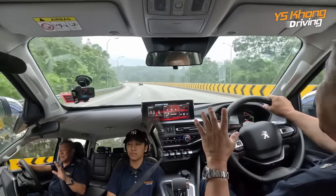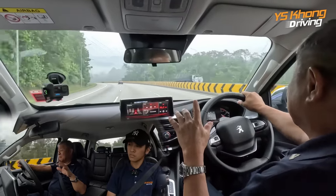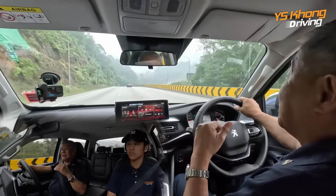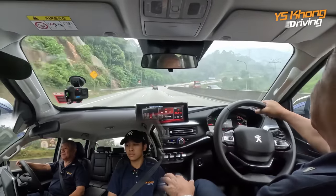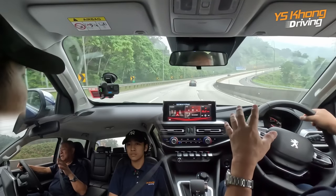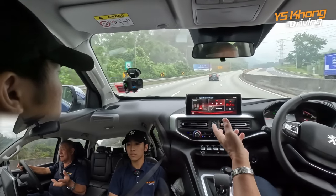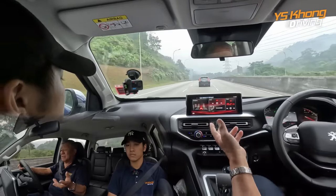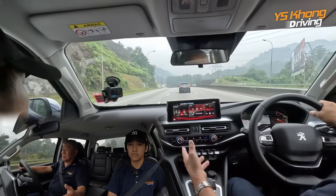Okay, this is 90. And the engine is pulling at a little bit above 1,600, 1,700 RPM. Yeah, that is the engine speed that you're pulling. And there's a 6-speed gearbox, of course, and it's automatic. So this means that the Landtrek is potentially very economical, and it should be as economical as any of the other diesels. And the fact that it's a 1.9 liter engine means it is more economical than, say, a 2.5 or 3 liter diesel, yeah? It's just because the capacity is smaller.